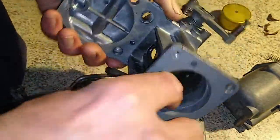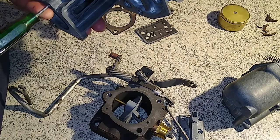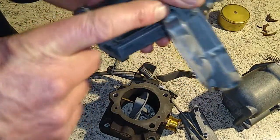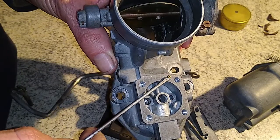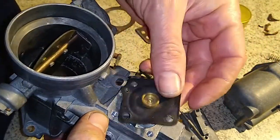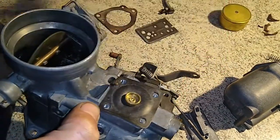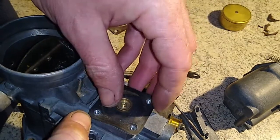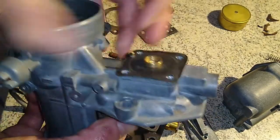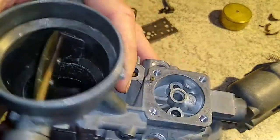The second drilling was for your economy valve. When you back off on the accelerator the throttle plate shuts, you end up with higher vacuum in the manifold below it. This port is fed high vacuum which comes up through here and out this little hole here. It has a diaphragm — this is your economy valve — with a spring pushing down on it. The housing goes over the top. As you back off on the accelerator it will lean the mixture out, which gives you a bit of economy if there is such a thing in a Bedford.